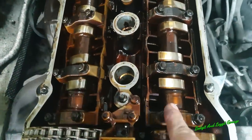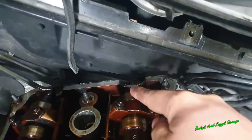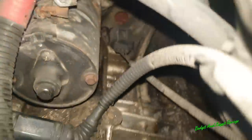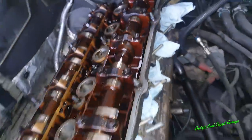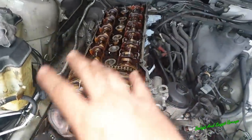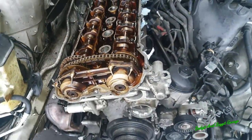We can see the two valve lobes are actually pointed together, which is good. They are again pointing straight up. Now just for the starter motor, you see down here, and anyway, there is the locking pin, and that's all good. So that's good enough now to take this off. And like I said, we've more or less got it timed.